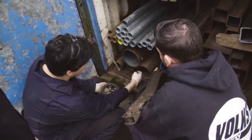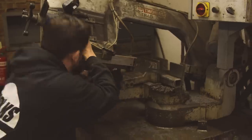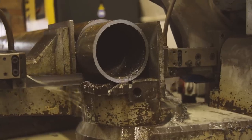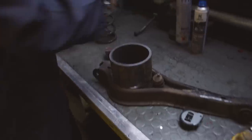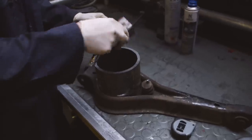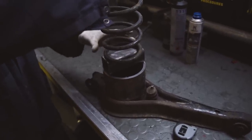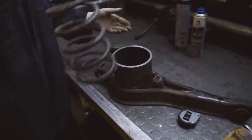It doesn't have to be circular — you could just put a piece of square tube across it, or drill a hole with an open bolt. Adam then cuts the box section that will be welded in place to act as a platform for the spring to sit on, and gets to work on the circular sleeves that will hold everything in place. We've got everything cut in the machine shop: the outer pipe goes in, seam welded across, dressed with a grinder — about 20 mil inside and 50 outside, giving us 50, 60, 70 mil of lift, exactly what we wanted. Although it looks really ghetto, there's been some engineering — 17 minutes of discussion.